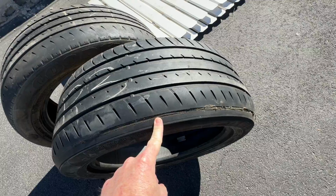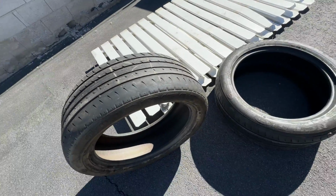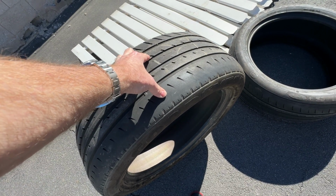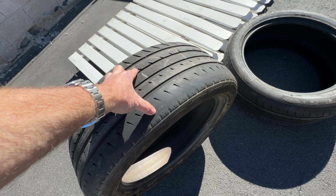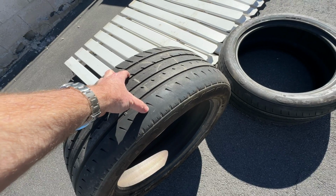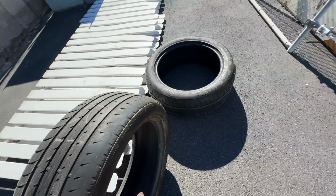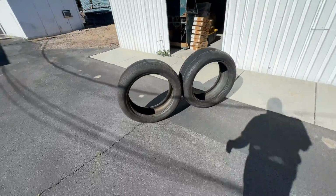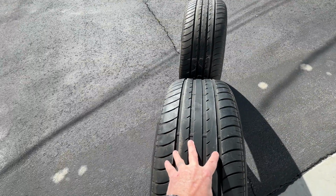That's the rear staggered wheel, right? And then this is probably on the same side. This is a front wheel. So it's eating up. So I've got to go get an alignment and toe and all that done, because this is what's happening. And it might have to do with those bad struts as well. So over here in the junk pile, these are the other side, right? So this is probably the passenger side, and it's good.